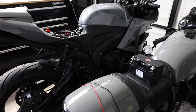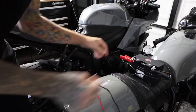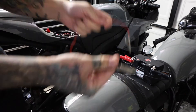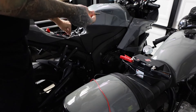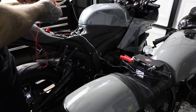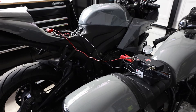I have a battery tender two amp — it's just a hot and a negative. We'll connect those to the battery that's dead. Next I'm going to connect two cables, also hot and cold, and these we will connect to the battery that's currently charged. What this is going to do is tell the charger that it has sufficient power and can actually send a charge, so we'll give that a go and come back to see how it does.